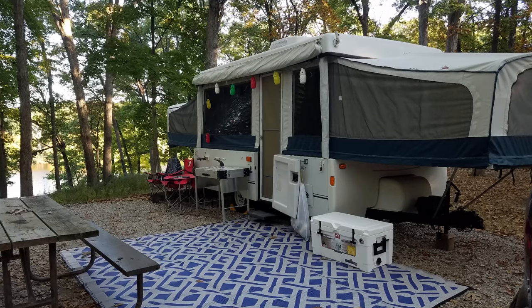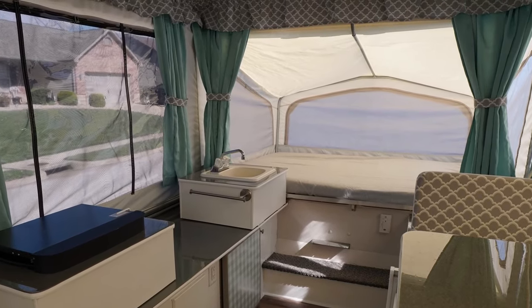After using a lot of Starbrite on our first pop-up, a 1998 or 1999 Jayco — where almost all the canvas material was true canvas — we found we had to completely redo the waterproofing. For a big job like that, pick up a gallon of waterproofing agent and one of those cheap pump sprayers, and wear a mask while doing it. If your camper only has true canvas on the windows, a half-gallon should work; if only the bunk-end windows are true canvas, a 16 or 32 ounce spray bottle is probably sufficient. Tailor the amount to your needs.